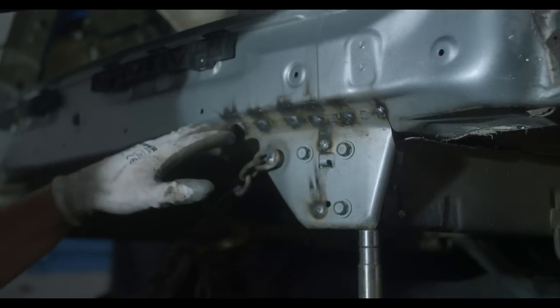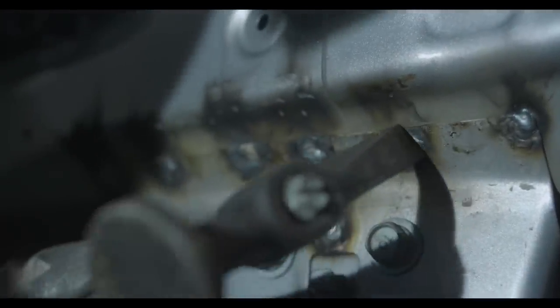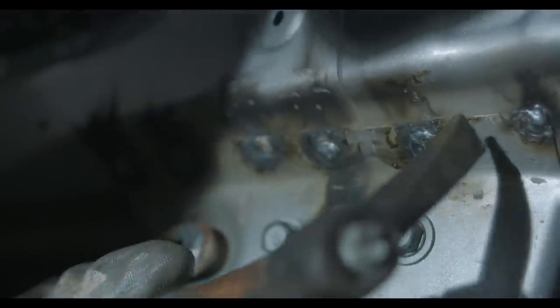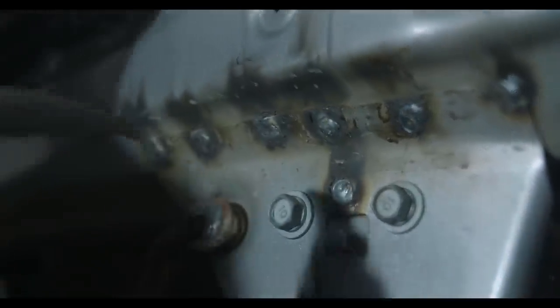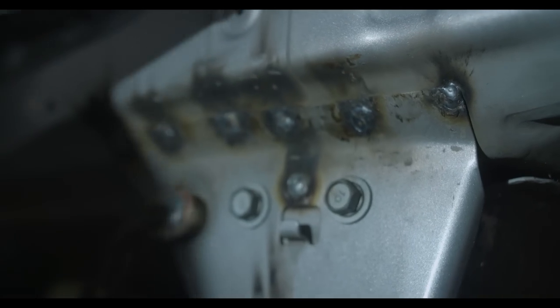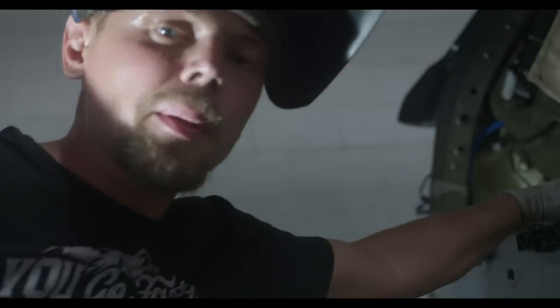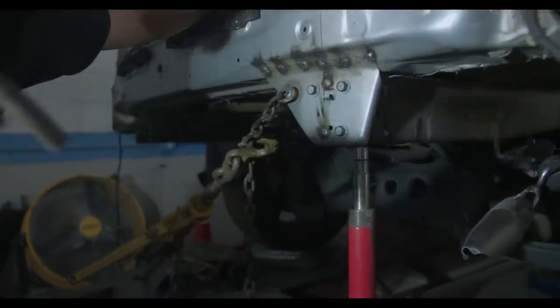Tight that seam is. You see that seam? The reason why it's so tight is because every time I weld it, I hammer it down. And when you hammer it down while it's still hot, it's going to stay in its shape. So what that's gonna do is make the metal super tight against the other metal, creating that factory finish. Not a lot of people are gonna tell you that. Not a lot of people gonna tell you their secrets, but I'm telling you.